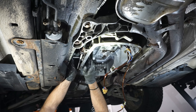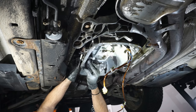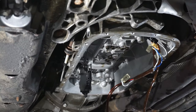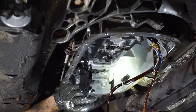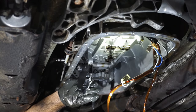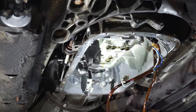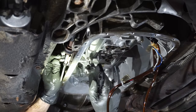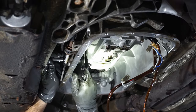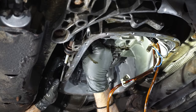Now move the shaft through to retain both pieces. Put the first dowel pin in on the outer side to limit the travel of the shaft. Grab your center punch. Drive it in. First dowel's in. The rod is in place.